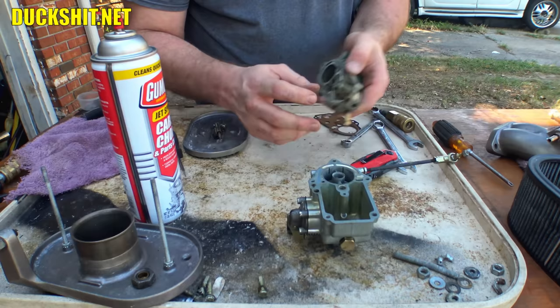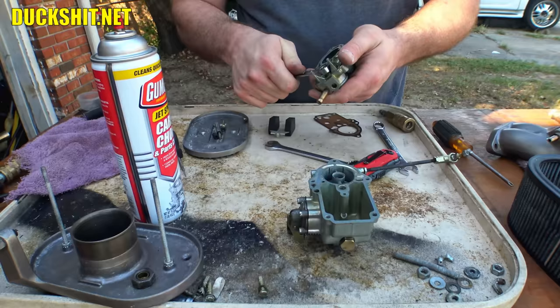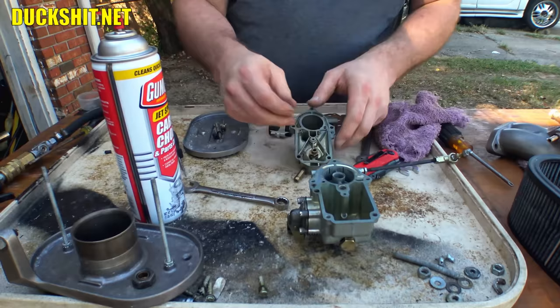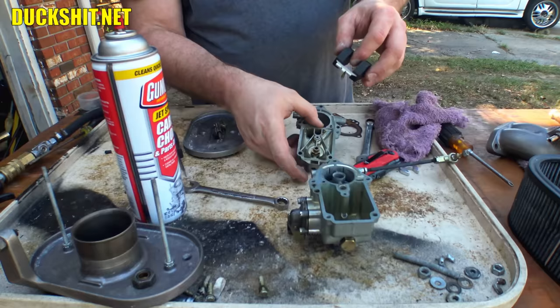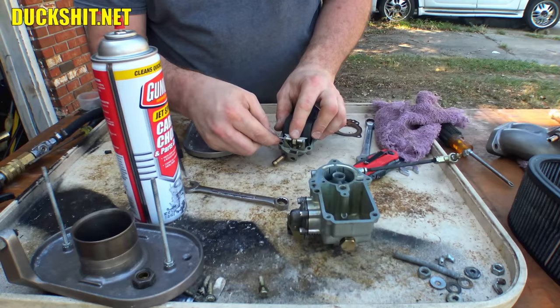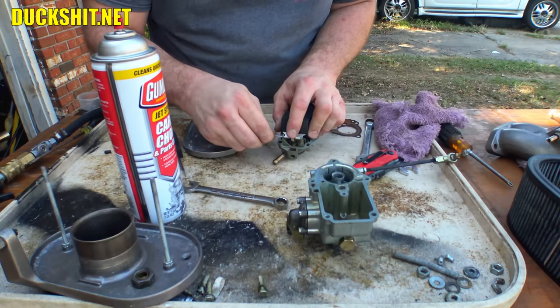These were in for about, I guess you saw the video already, they're in for about 25-30 minutes. I pulled it out a little bit before the 30 minute. But there it is. Okay. Gotta set the float height, and I'm gonna have to check the manual on that, so it might be coming back to that. It may not happen in this video, but it is one of those things I'm going to have to check. And then our pin goes in. There she goes. Yeah, you got a working float.